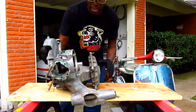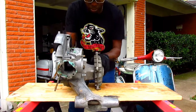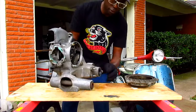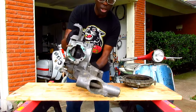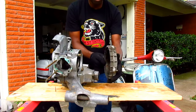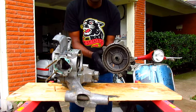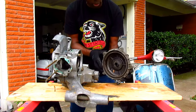I was going to talk about this side stand just a little more so you can understand. This would be the normal setup of a Vespa motor. You take the wheel off and if it's sitting there leaning over like this, the oil sits level in here right up to this oil seal. Leaning over like this, you can get a leak inside your rear brake drum. This is where your brake shoes are and it always ends up with oil in here. This brake drum is really oily from that happening to the previous owner of this particular scooter.